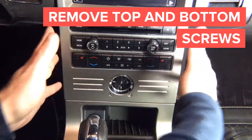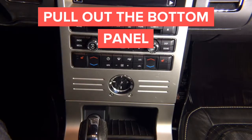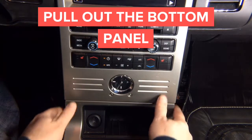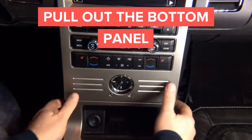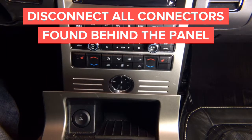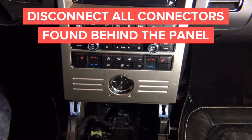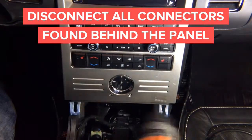First remove this panel starting from the top. You'll pop the panel open, then you're going to have to shift the vehicle into gear. There are two big long clips — pull on them carefully, being very careful not to break anything. The panel comes out. Disconnect the switch if you have one, and disconnect another connector for the light. Pull the panel out. Now you've got two screws over here to remove, plus screws on each side behind this panel.